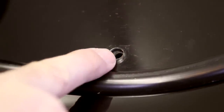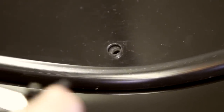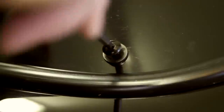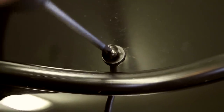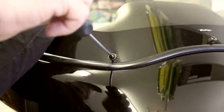This is the inlet — you'll see there's a little brass fitting in there. You want to make sure that you have your hand at the top of the fairing windshield so you can give it a good lineup right here. This is nothing to hurry yourself through — just take it nice and easy, work it in gently. Don't over-pressure it; you can control the height by your hand at the top. When you get everything in, go around and work from one end to the other so you balance the tightening of the screws.